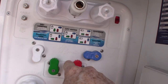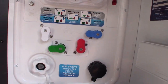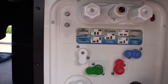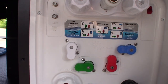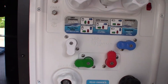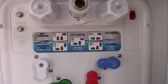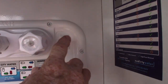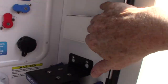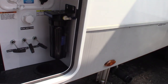It's got pictures of each valve position. Right now we'll go to city water — you can see the white, green, red, and blue handles. If you need to fill your fresh water tank because you're camping without city water, switch it to the fill position. When you get to where you're going, switch to pump mode and it'll pump from the tank. There's also winterizing and sanitizing positions. You can operate your water pump from outside or inside. There's a cable and satellite hookup, power, and a water filter canister — if you use a carbon filter, change it every season.